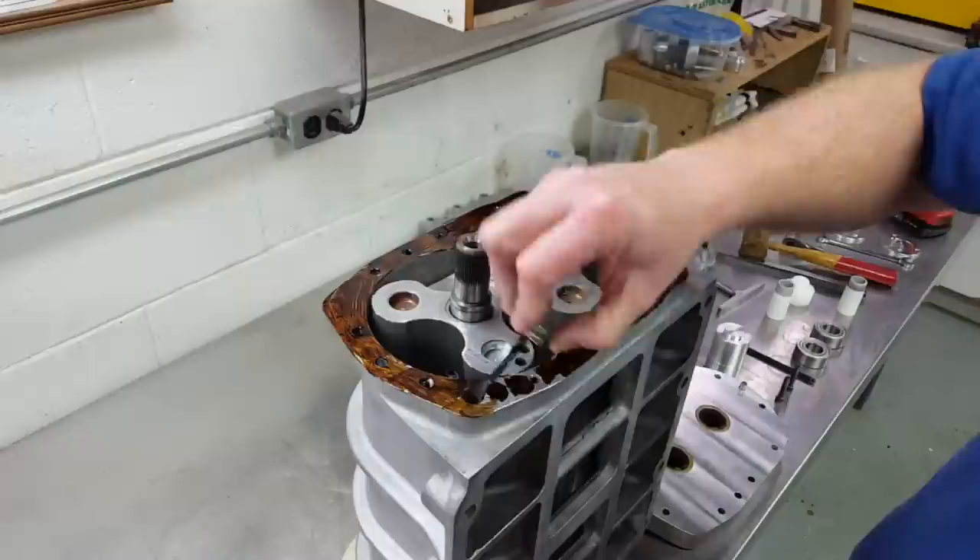Next, I removed my gear spacers. Then, before putting the gears back on, I made sure that on the passenger side rotor I reinstalled the ten-thousandths-thick shim that was originally there when this blower was assembled on a diesel engine. Even though I'm not going to keep this shim, I still wanted to make sure that I had a good starting point for checking my rotor timing.